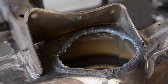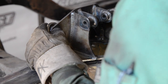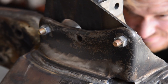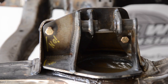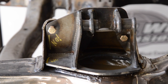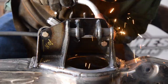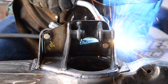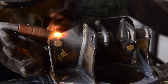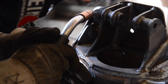You can see how that worked. You may have to do a little bit of cleanup, but you want to install the extended travel mount up inside there and it should fit really nice. You may have to do a little buffing here or there. We give you a couple of setup bolts to install in the frame to hold it in position. There's a gusset that goes into the bracket that you're going to be welding, so weld completely around the extended travel mount. Put the gusset in there and then weld that portion in.